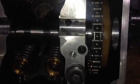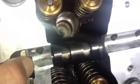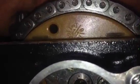Putting in the cam lock cap again, closing up the cam chain tensioner. From this side you can see the tensioner is sitting on the chain and it's been preload checked. Taking out the cam tool lock and dropping in the lock at the back. Now if you want to check the timing, that's how you do it, and everything seems perfect for now — red lock it out.